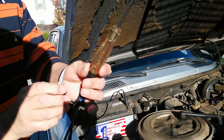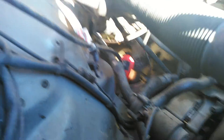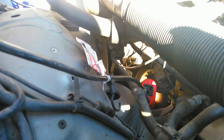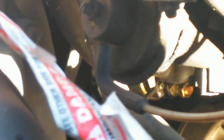From there, you're going to take the probe and go down here to the starter. In here there's a small Phillips head screw that has probably an 8 or 10 gauge wire on it, running from the ignition switch and the dash that has the lock cylinder. It goes directly to this wire here that's attached to your starter solenoid.